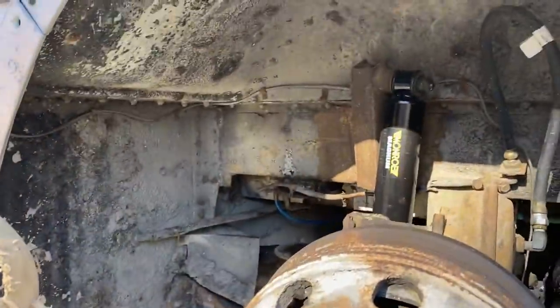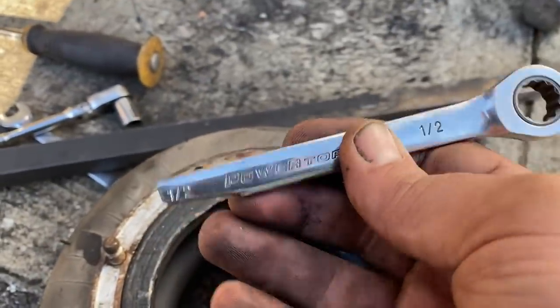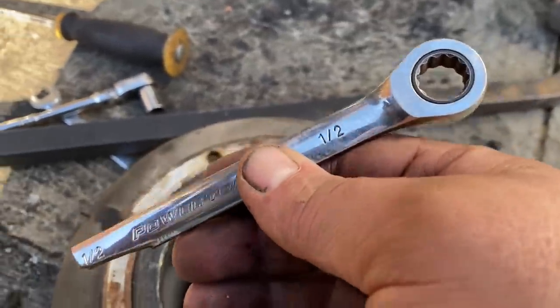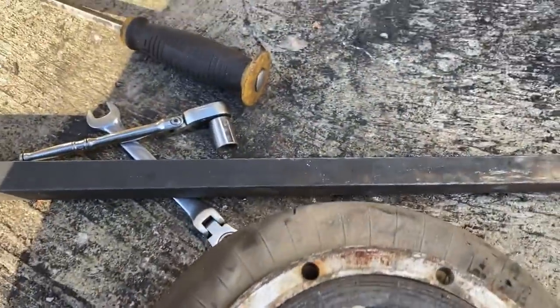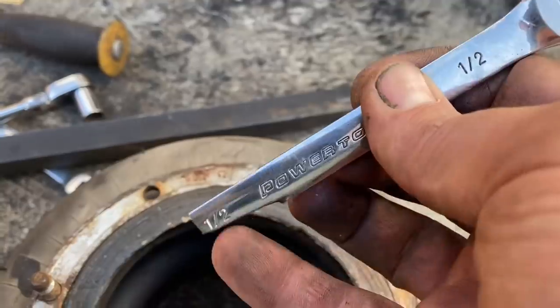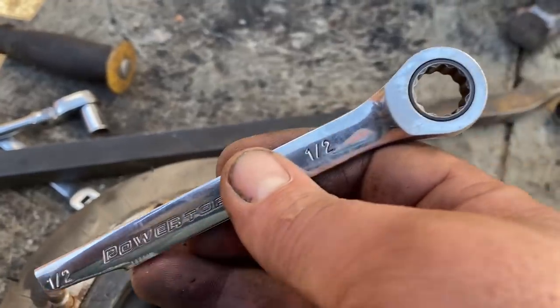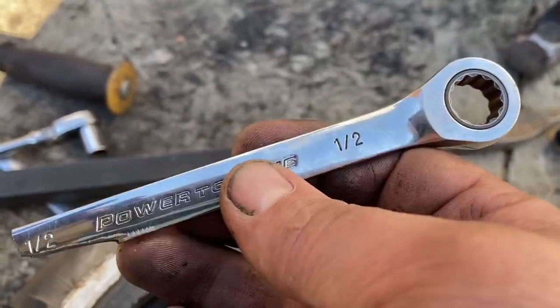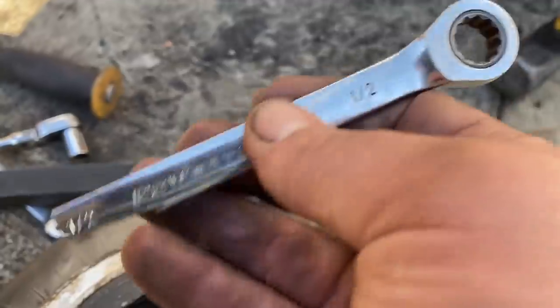I got this other front airbag off. One of these bolts you could not get to at all — we had to sacrifice a wrench and make it work. We couldn't even get a single ratchet on it; no socket would fit, even quarter inch drive, nothing with a swivel. We tried multiple different options — curved wrenches, flex head ratcheting — nothing would get in there. We used a regular ratcheting wrench, shaved the side off, and had just enough to get one click and still enough torque. The mini shorty ratcheting wrench couldn't get any torque — you can only reach it with your fingertips. So we sacrificed a wrench but it got it off. He's been fighting that for days.